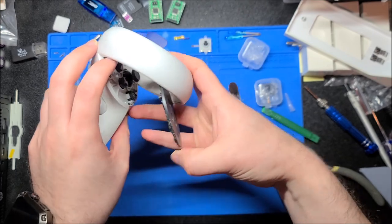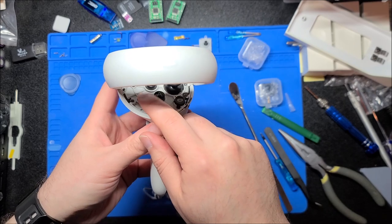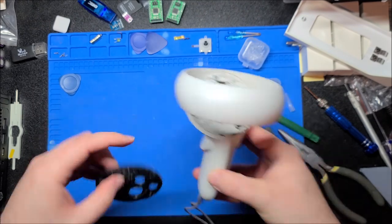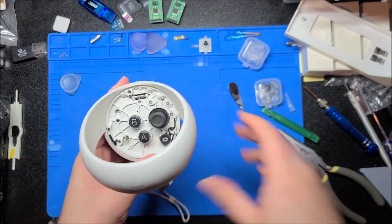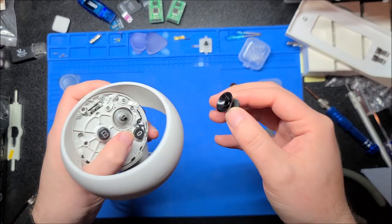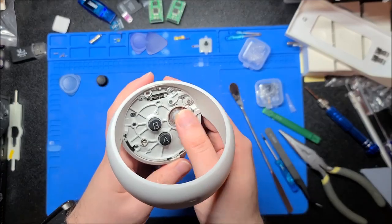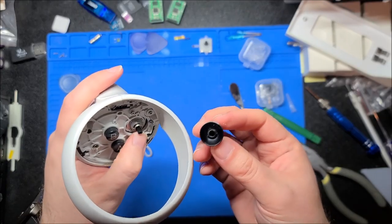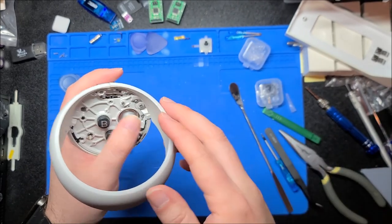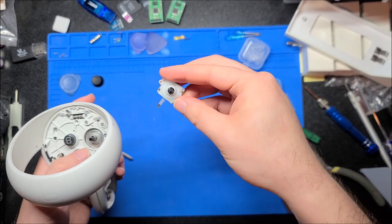We're going to remove this disc — you can see the black adhesive double-sticky pad. So that's off. Now we have that spring I was talking about — that's actually the capacitive sensor. This part of the pad is a thumb rest and it can sense touch because there's a piece of metal there that touches the spring, making it capacitively coupled. We have the buttons and the joystick. We can pull the cap off at this point. If the spring tries to come along, just use your finger to detach it.